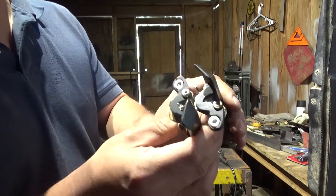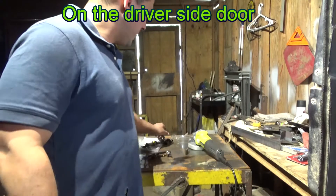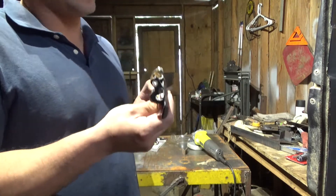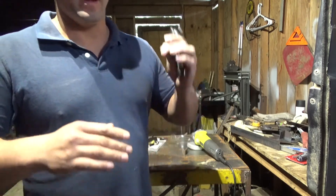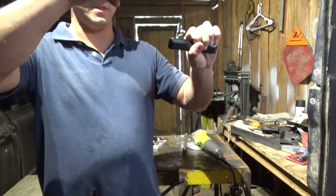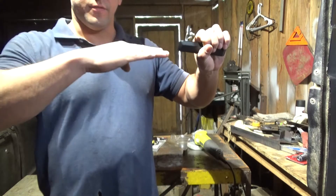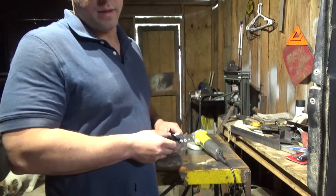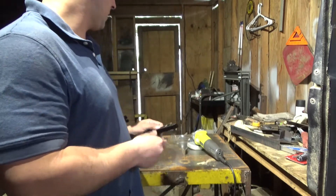I actually took out a pretty good amount. So what I wanted to do was I installed a low range off-road handle and it opens no problem without even adjusting it. On these you can actually run the adjustment all the way up to where it will open, but it's no longer a free pin fit. What I mean by that is on an adjustment, you're supposed to have the hole and the pin go in level and freely. You're not supposed to have to squish the rod really far down just to get it in the hole, because if you do that, you're essentially halfway opening the door. Your door might fly open when you don't want it to, so I don't do that.